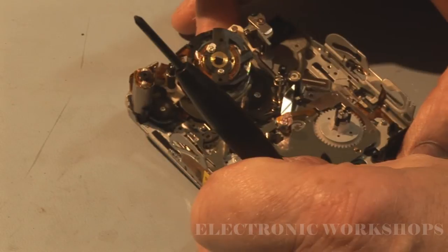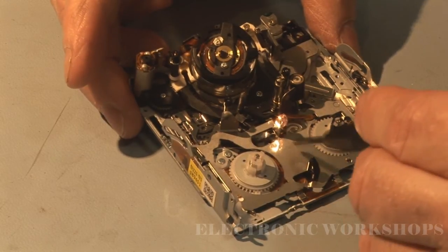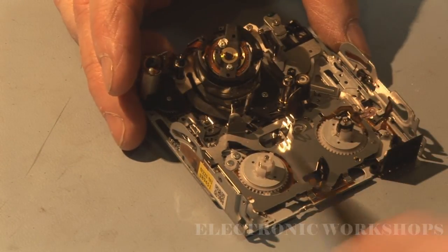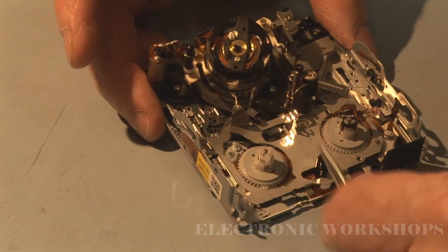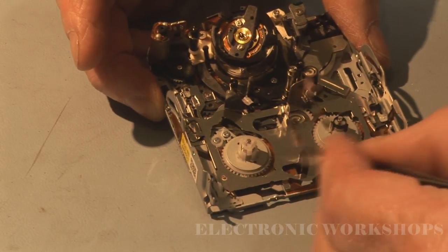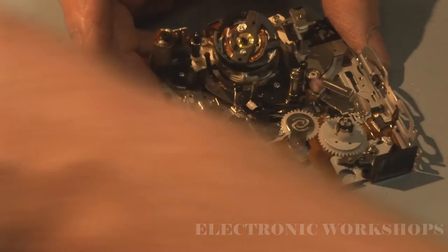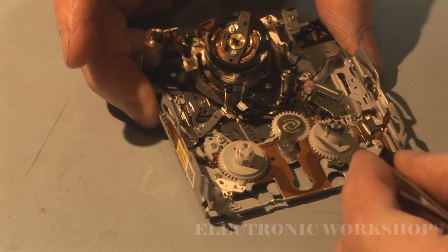Now this is where I've got to be careful. I've got to remove this item here and the first thing I've got to do is take out this lamp, then there's one screw over here, and then we've got to slide it - there are two little retainers here, one here and one here - just slide it towards the heads and lift a little bit at the same time. That's out of the way. You can't turn this deck over now because bits will fall out, so you have to be pretty careful.